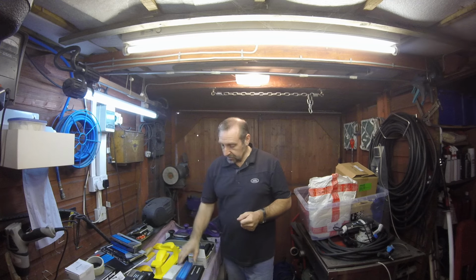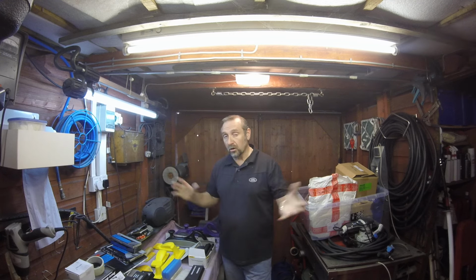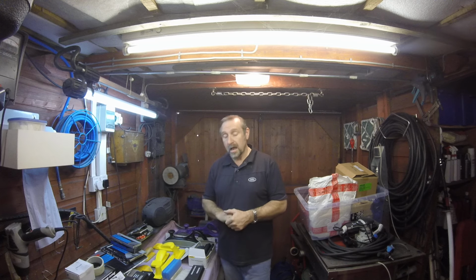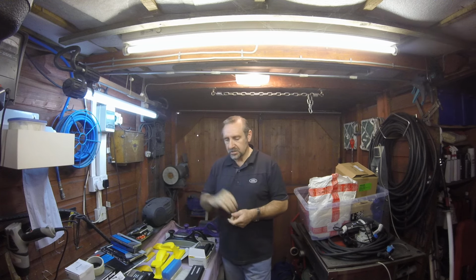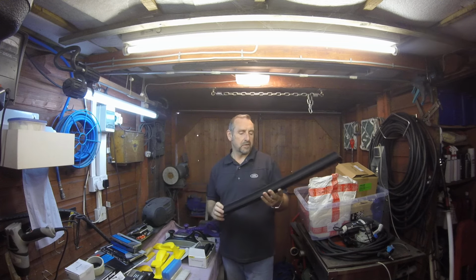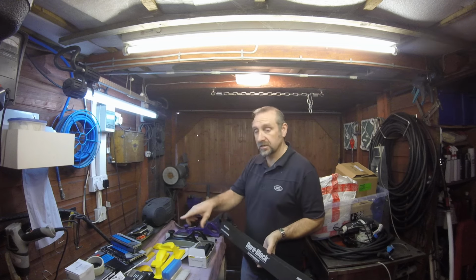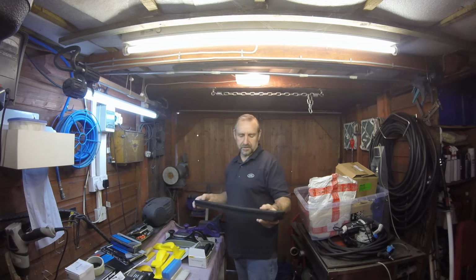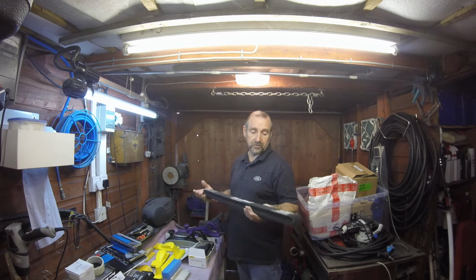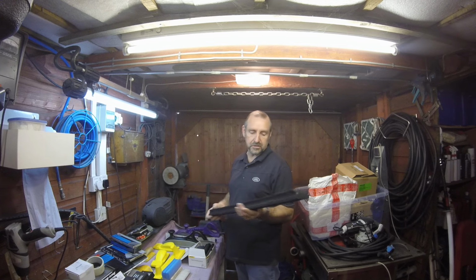Last video I was talking about if you're sanding down a roof skin or a whole door, a big door, a panel van that's still got a slight curve in it, you need to go onto a marine board. This is my marine board, once again Dura-Block. It's the same manufacturer as the kit, but these come separate, they don't come in the kit. I've got this one, and I've also got the, I think it's 36 or 40-inch one as well.